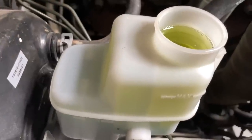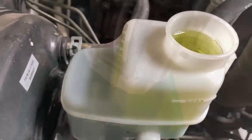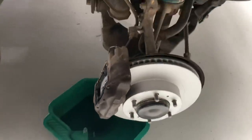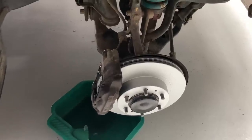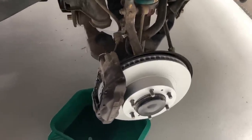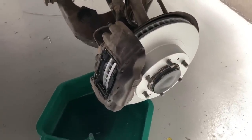We've done a lot of brake fluid flushes on a lot of vehicles over the years. Even if we've got 99% out and there's 1% left, just wait a while and all that blue stuff will be back again and fill the whole thing. And you'll be thinking they haven't done the brake fluid — but yes, watch and see. It might even happen in this video. No moving parts. No need to pump the pedal. No need for a second person. No need for expensive or cheap tools. It's called gravity bleeding. It works the best — that's what I was taught from the start and in my opinion, gravity bleeding works the best.